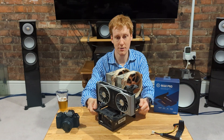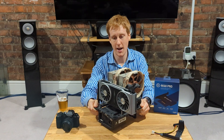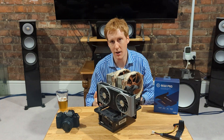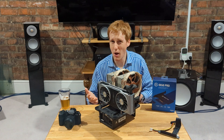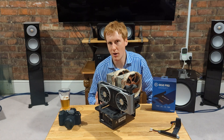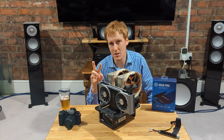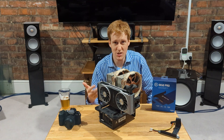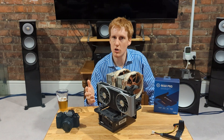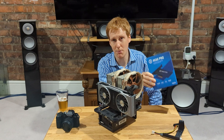But the elephant in the room is my PC — it's a mini ITX machine. Now, if I was being extravagant, I could go out and get a new board with more PCI lanes, but it's a bit overkill. Plus, this is HomeLab, right? So I thought, what can I do to jerry-rig some solution? Fortunately, my motherboard has two NVMe slots, and NVMe is just PCI under the hood. So I thought, how can I use my other M.2 slot to expand my PCI capabilities?